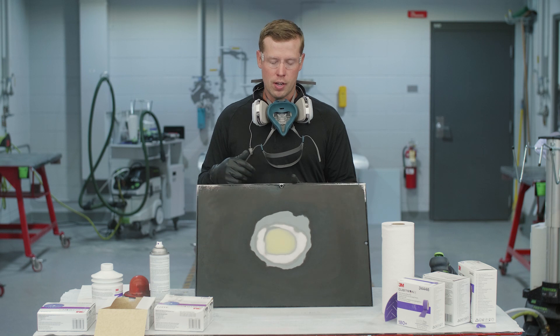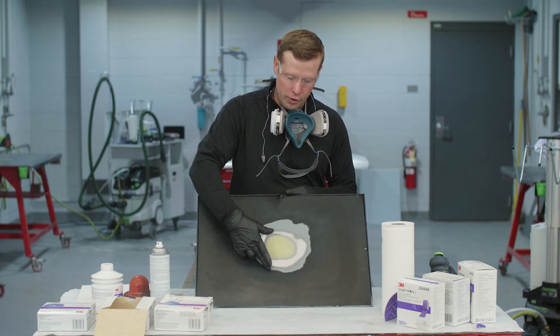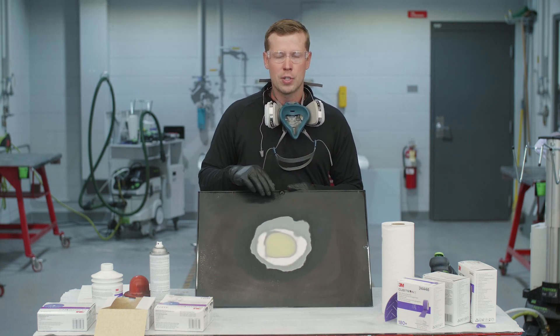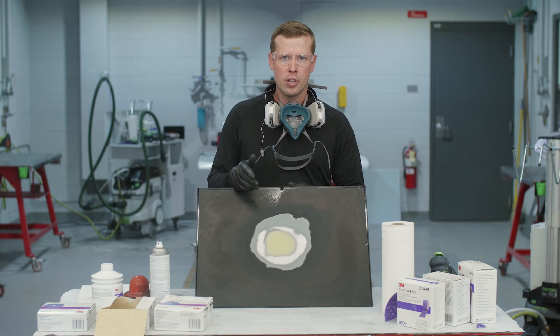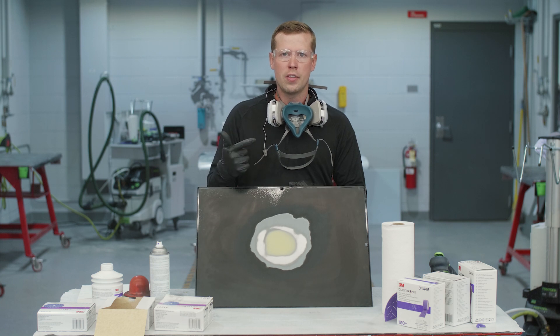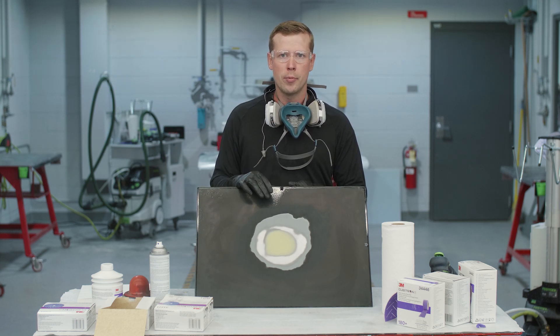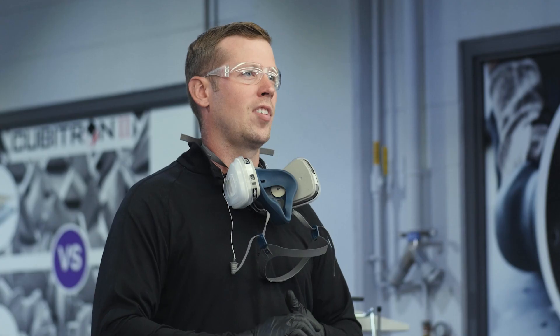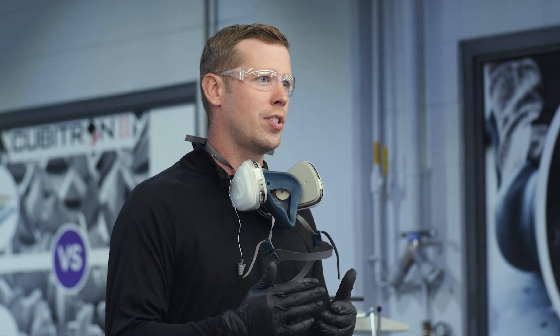As you can see, we've finished the body filler sanding. We've taken the time to fully feather out and refine the inline sand scratches on the outer perimeter in the original paintwork, and at this point we're ready to move to glaze. When it comes time to apply and sand your glaze, apply all the same principles: use dry guide coat, take the time to refine inline sand scratches before moving to primer. If you keep these tips and best practices in mind, we should be able to avoid repair mapping. That's all for today — please comment, share, subscribe, or visit 3M Collision Repair Academy for more videos.